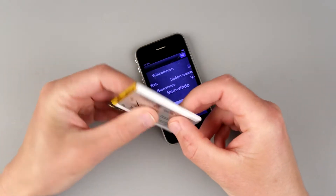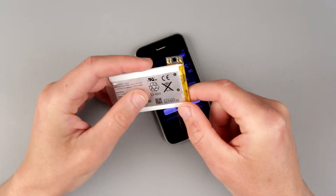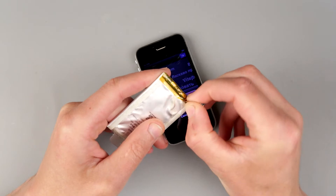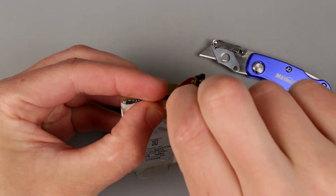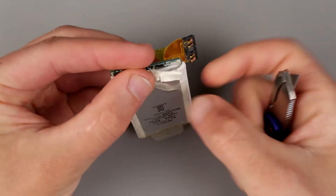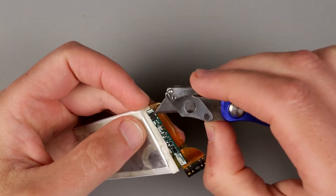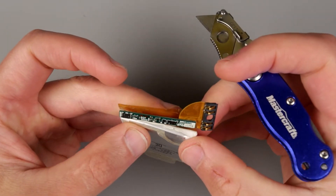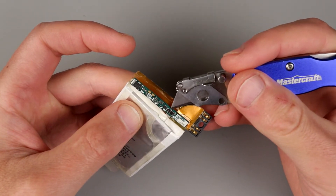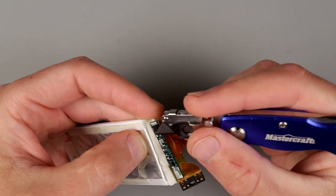Here's the original battery. I wasn't too gentle with it — it got bent a little bit when I tried to disconnect it from the phone. The other interesting thing about the battery: it looks like this battery has a little bit more circuitry in it, and I'm not sure what kind of stuff this is for. Let me peel more off to show you what's going on here. Wow, that's quite a big component, and there are two of them — those are probably MOSFETs, because they clearly have many pins shorted together. So those two are MOSFETs.